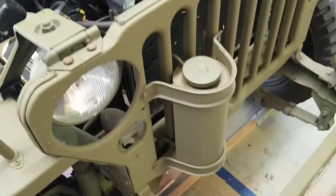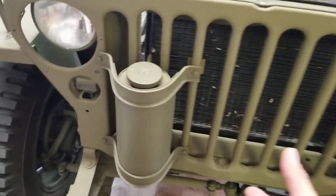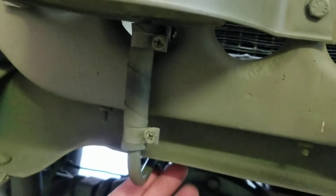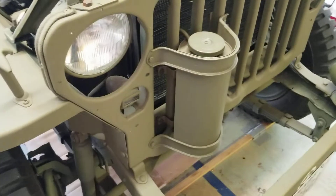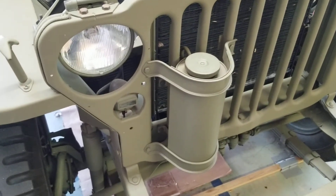So there you go, a little overview of the desert cooler. Sometimes I see photographs of this being mounted a bit higher up on the grill — I think that would be more ideal. The tubing kit that came with the desert cooler I'm using is intended to be mounted so that it goes underneath the crossbar, underneath the radiator, and then back up, clamped through hose clamps to the stock output tube from the radiator filler neck. That's where mine fits, and it still does the job — once the engine cools down, it just sucks the coolant right back into the engine.